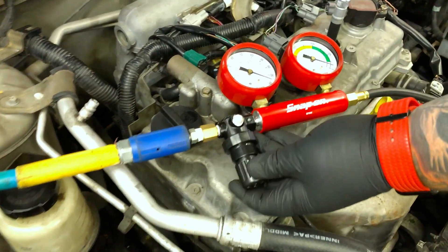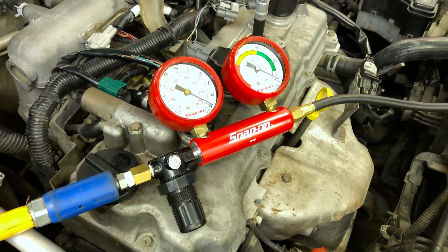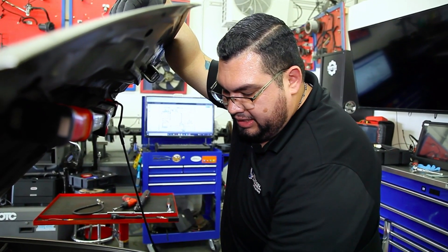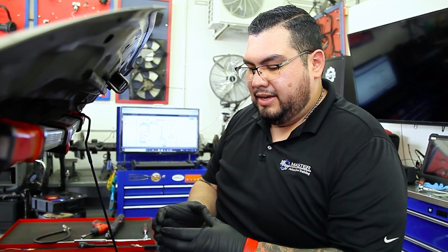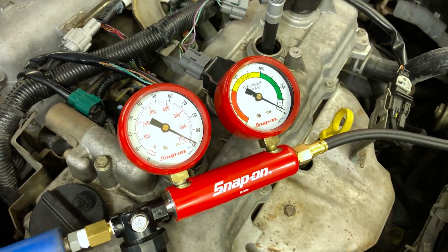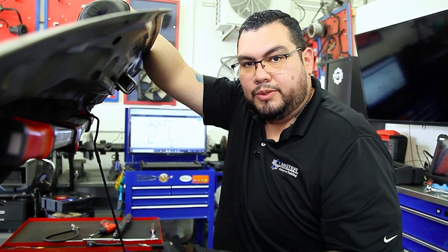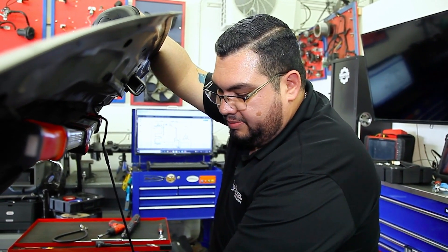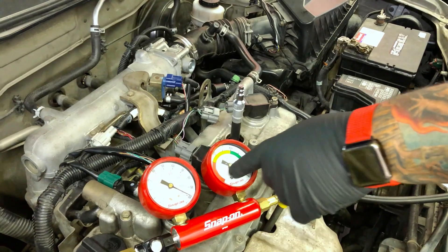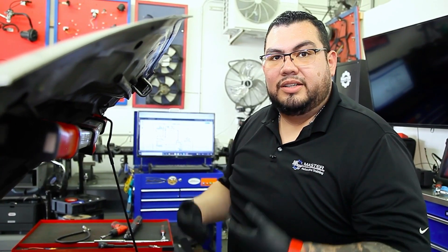When you're looking at your leak down tester, always make sure it's set to zero before you connect it to the cylinder. Keep in mind that no matter whether this engine is brand new or has 150,000 miles, it's always going to have some sort of compression loss. The reason being is piston rings always have what we call end gaps, and those end gaps are always going to allow a little bit of compression to escape. Looking at the green section here, we can have up to 40% loss and that's still going to be okay. Even an engine right out of the box from the factory might have up to 20% loss, which is absolutely normal. Now that we've hand cranked the engine and have it set up, we'll go ahead and connect it — we're just looking to make sure the needle comes and stays within the green area.